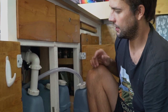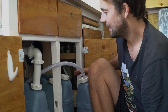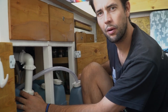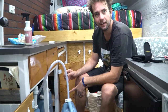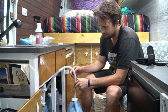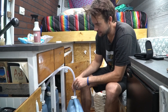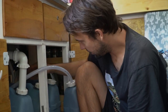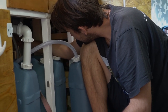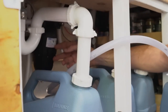I'm going to show you real quick what we've got going on in here. We have these Reliance BPA-free six-gallon jugs — we got three of them, so we have 18 gallons of fresh water. We have one six-gallon gray water jug. We empty that out rarely — we still kind of do our dishes as if we were camping. Most of these sink hoses we just bought at the hardware store; they're half-inch piping. We actually use quite a bit of tubing because we had read that if the water travels a further distance and loops around, the sink pump's quieter. I don't think that really was the case, but you can just buy these tubes — they're half-inch, pretty standard tubing, cut to length. We have a SureFlow pump and we also have an accumulator tank. We've noticed that actually helps quite a bit with pressure and sound.